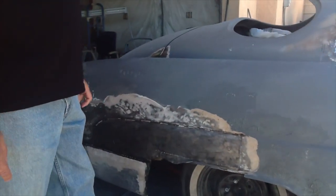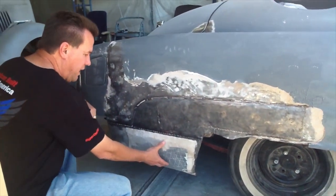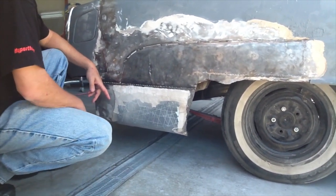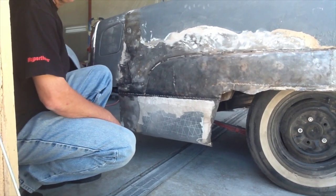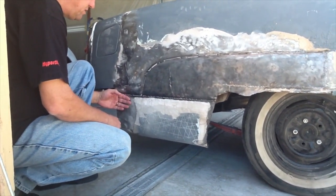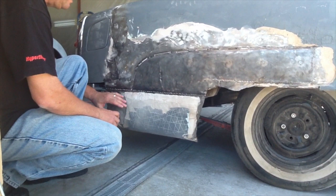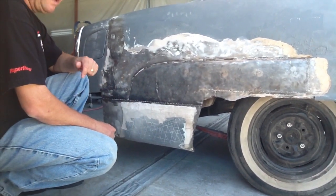This is right where I got into trouble and where I decided to call in Tim for his expertise. You can see this rear quarter here is obviously a mess. What Tim was able to point out was there's at least a half inch of bondo right here — I call these a bondo foul. The guys that worked on this before didn't have any skill level; they ran a piece of straight sheet metal here instead of radiusing it to the body line, then used bondo to try to mimic and fill in the body line radius. That's a mess.